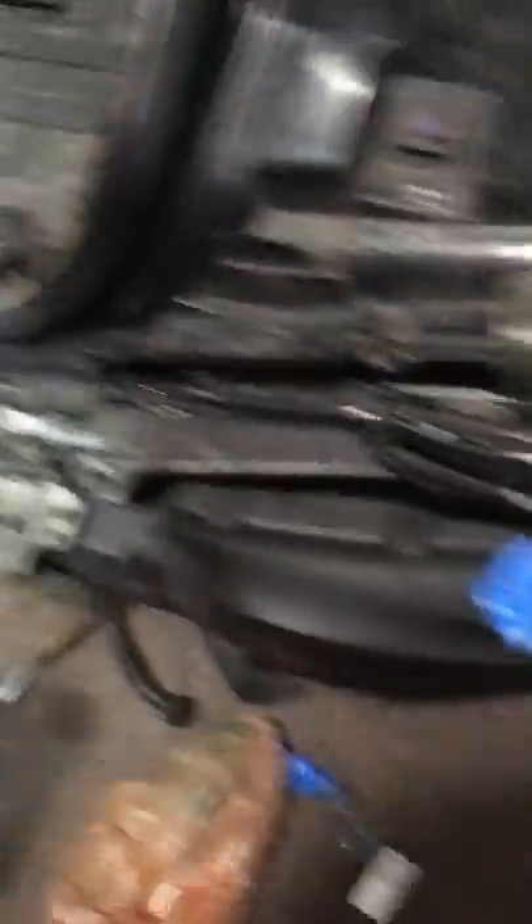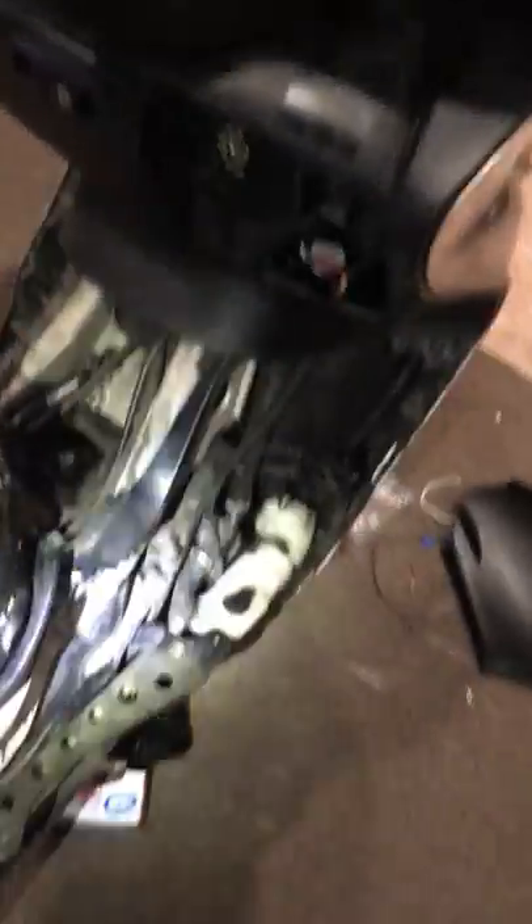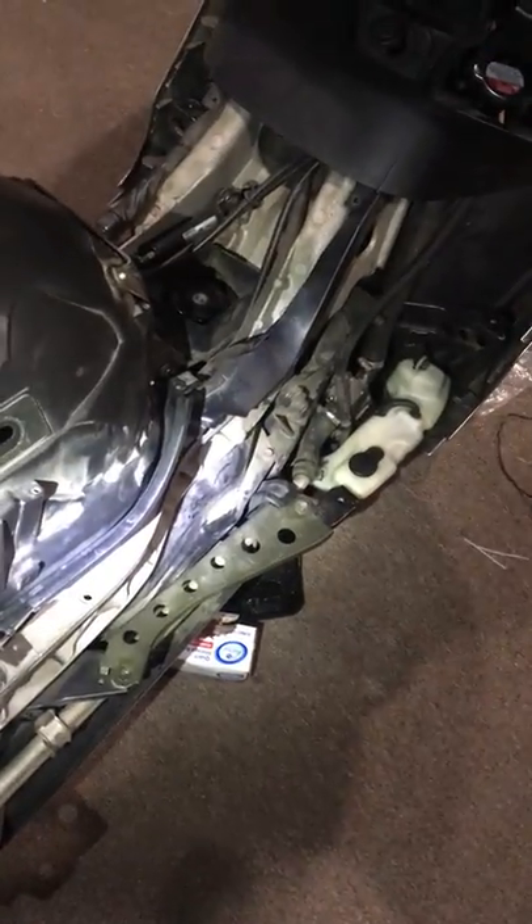It took a little longer because I had to take the tupperware off the motorcycle — that's an extra hour or two. But I got to use these heavy-duty trailer wires with the fuse in the back. It's easy to pop off a panel in case I fry a fuse, and I don't risk frying any of the built-in electronics, which on this motorcycle would be a shame.